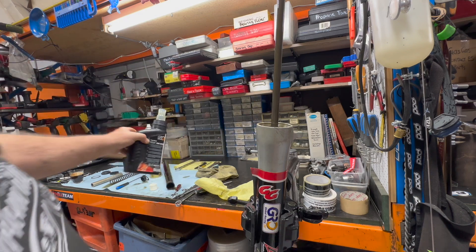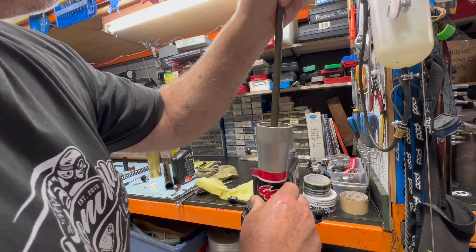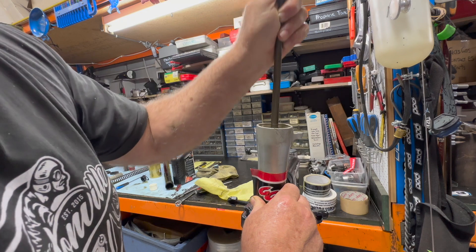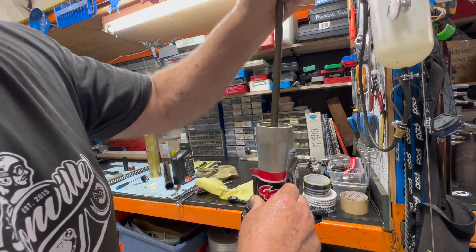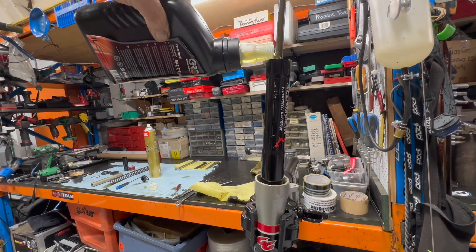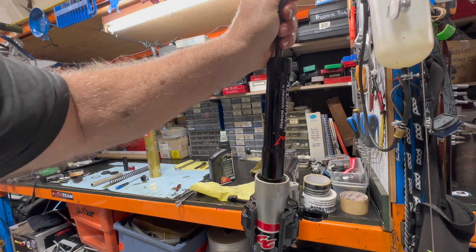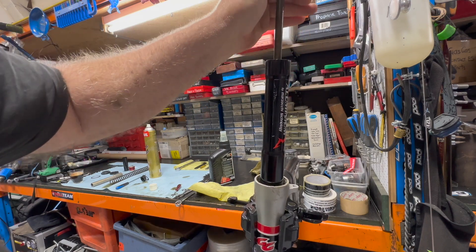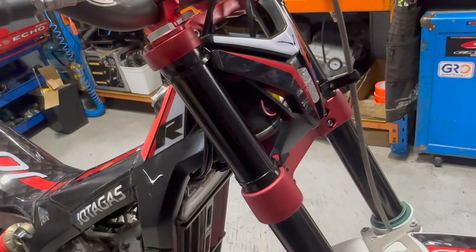Once that's done, pour some oil into the leg. The object is to stroke the upper rod and make sure there are no air bubbles — you can feel it if there's air, it just pushes through really quickly. You want resistance in both directions, so give it a bit of a stroke and make sure it feels good. I've already changed the bushes and changed the lower oil seal so it's all ready to go. I'm happy that it's gone in well. I've put the upper fork leg back in and I'm going to top it up to a 160mm air gap, then slide it all back together. That's got it covered. If you'd like any of the parts or manuals, they're available on the Hellteam website. Please like and subscribe below and we'll come back with more bike tech reviews and workshop tips from the Hellteam Trials Workshop.